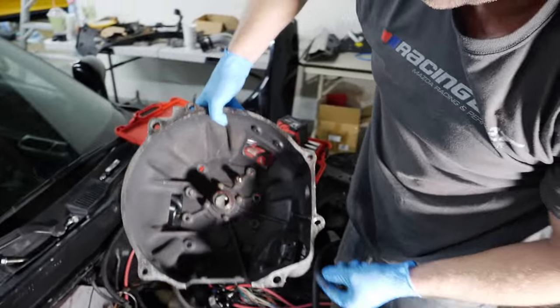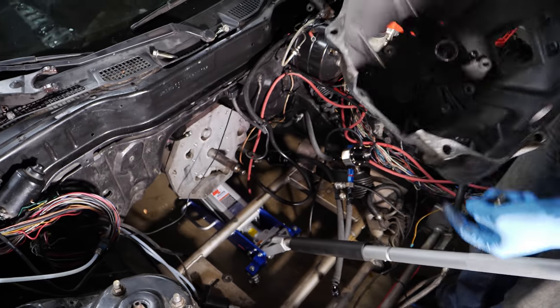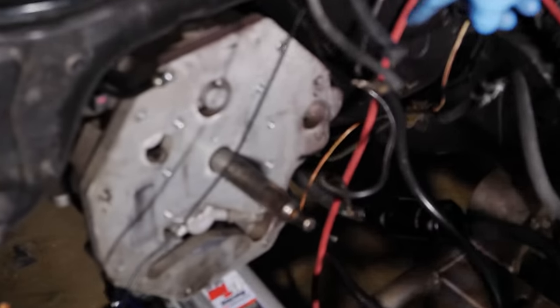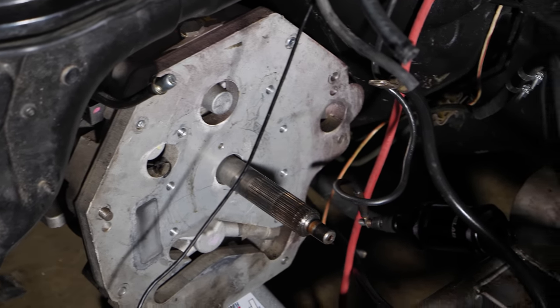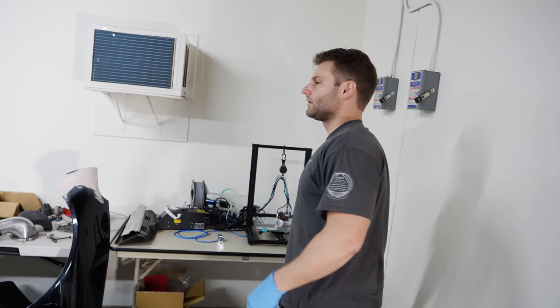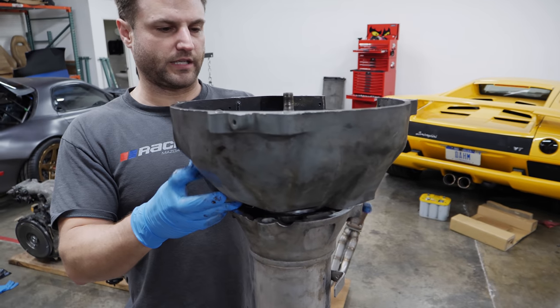Unfortunately the adapter for the torque tube is different than the other adapter — I wish I could just buy it and call it a day, but that's not the case. That adapter even has room for a different type of throwout bearing, but that's not what we're using. Our adapter will have at least eight bolts threaded in those spots, and there'll be another set of bolts for the torque tube six-bolt setup on the other side. You can see that input shaft spline — look how long that is, tons of splines. I need to see something like that on the end of the torque tube, give or take an inch.